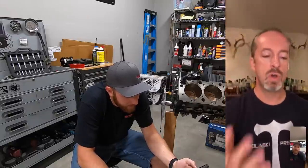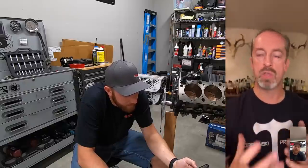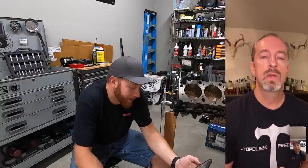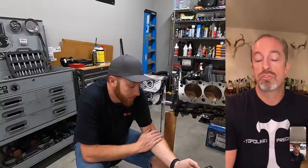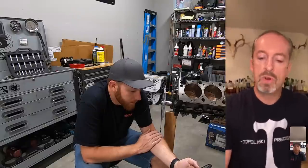You have to know where your intake center line is if you truly care about how your engine will run and building something for a specific application. So that's gonna push my power band a little bit lower. Well, it traps air sooner in the cycle. So cylinder pressure trapped earlier in the cycle builds cylinder pressure at lower RPM.